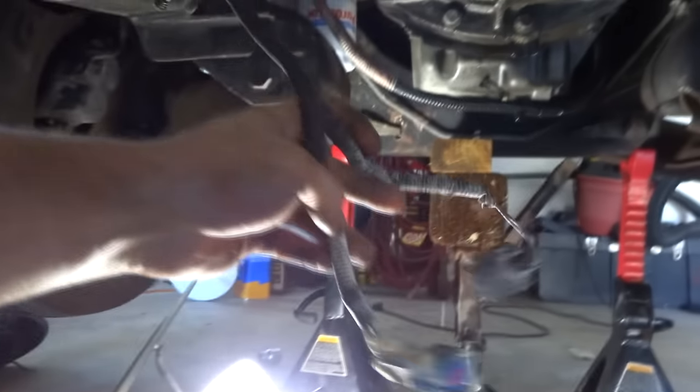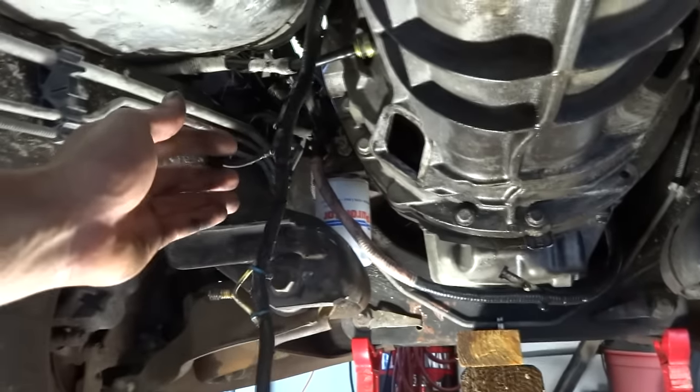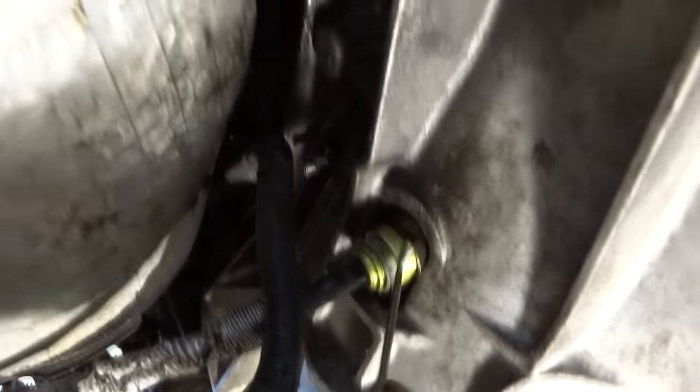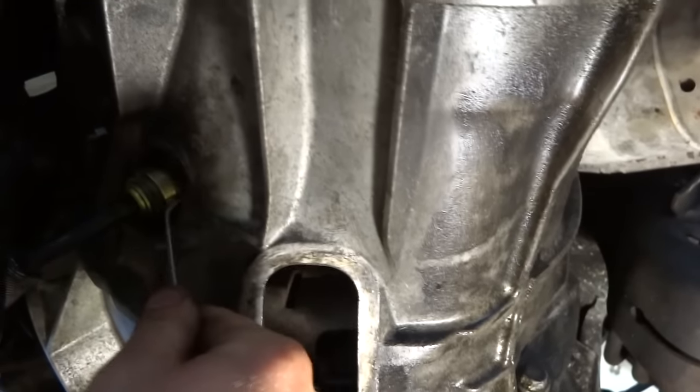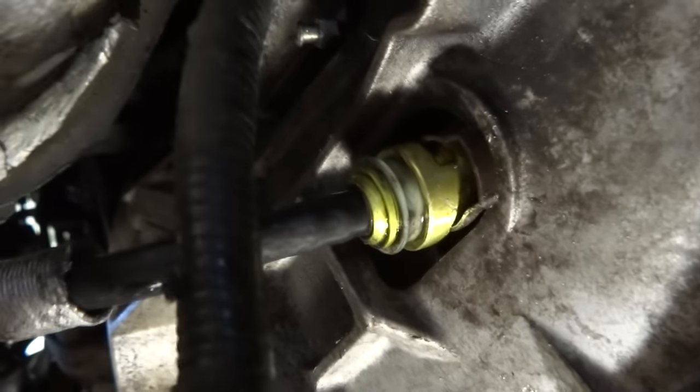As far as sensors go, we've got a sensor here, a sensor on the back, and one more clipped right here — you've got to unclip it. So we have one, two, three sensors. For the clutch cylinder, pop a flathead in there, spin it around, and the clip should pop right out. Get a bigger flathead and pop it out — you just stick the flathead in there, pop it out, and the line will pull right out. Before taking the starter off, disconnect the positive terminal on the battery.